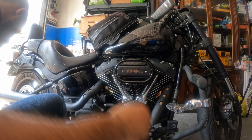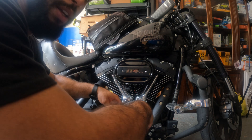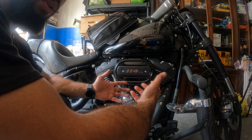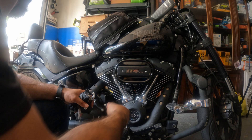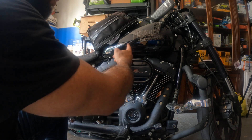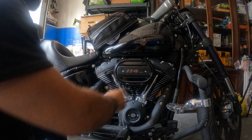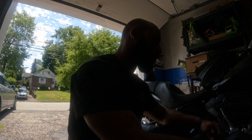Boom, now it's on. I'm going to wipe this down to get all my hand grease off. And that is how you change your air filter. Please don't wait three years like I did — I'm pretty sure the bike was suffering for it. Sometimes it wouldn't start right in the morning and would sound kind of rough. That is how you do an air intake replacement on a 2021 Low Rider S. A lot of 2021 models with this oval-shaped air intake will be roughly the same: two bolts on the outer plate, two bolts underneath, replace the filter, put the plates back on, tighten them up, and you're done. Please remember to like, share, and subscribe. This is all maintenance made easy — thank you for tuning in, I'll catch you on the next one.